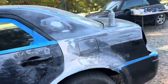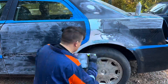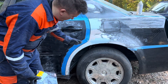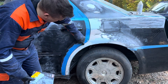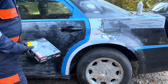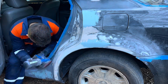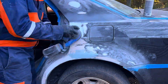In this section I'll be using the filler primer to get things started, and also I'm going to use the black sandable primer, which is a similar color to the car — it'll be a lot easier to tell what's really going on. That area I applied Bondo to had some low spots and I want to make sure I even everything out. Even though this is an 18-year-old vehicle and it's probably not even worth it, to my eye it's worth it — I want to make sure my eye is satisfied when I'm looking at it.